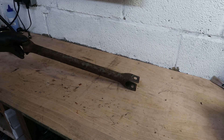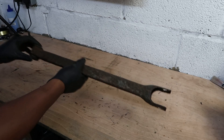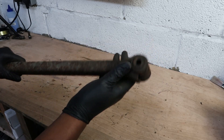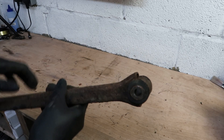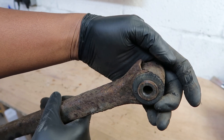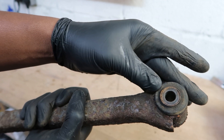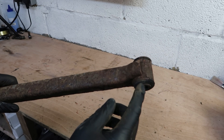So here we've got the control arm - the infamous control arm. As you can see, it's just a plain cast piece of metal. The main area of fault on these are the bushings, as per usual. The common point of failure is the bushing - can you see how cracked it is on the end there? They're starting to split. When they start to split, they're degrading. These are original, which is quite good, but they are degrading and they're on the way out.